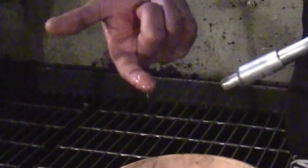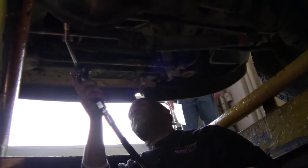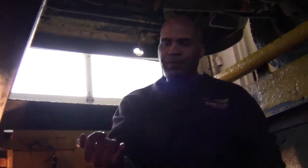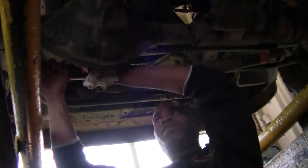It should be a clear color like this. You want to fill it just right to the tip of the front differential so you can check the level. Now you check it to make sure the level is full — and it is, and it's nice and clean. You put the check plug back in, tighten her down, and that is the completion of the front differential.